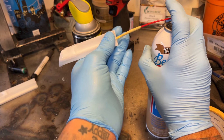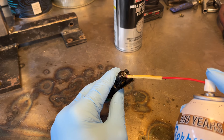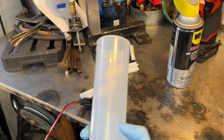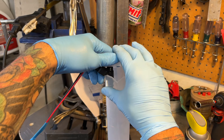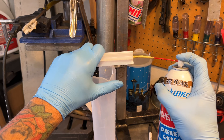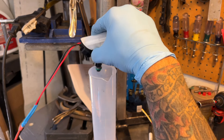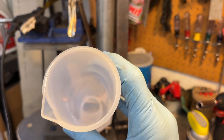Let's give it a go — yep, it's sealed. Hold on to that sucker. Now you never want to run these injectors dry, so before we hook it up to our tester we're just going to fill it with some of this cleaner. We'll hook up our injector and use a graduated cylinder as a catch can. And that's pulsing. We only pumped about 25 milliliters through there — that's enough to make sure it's clean.